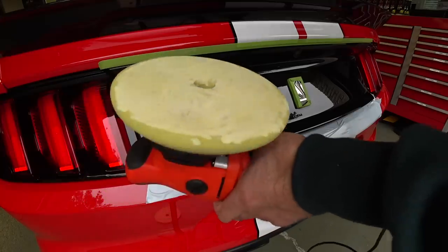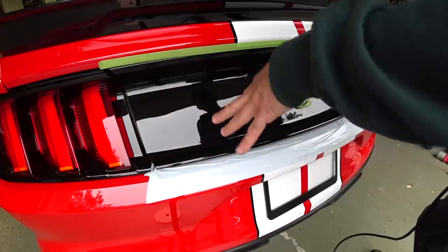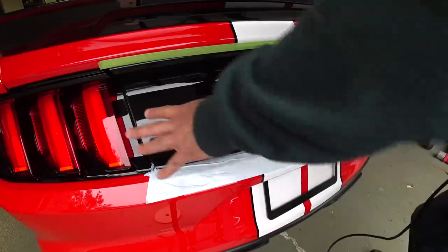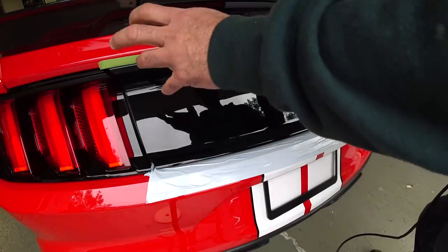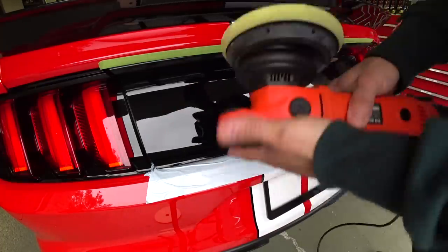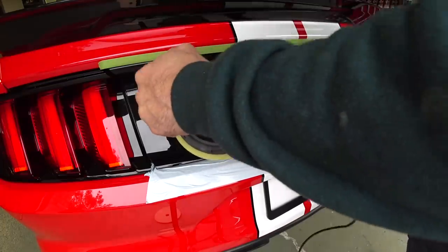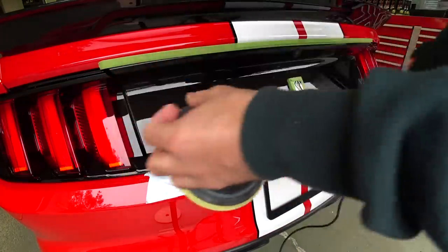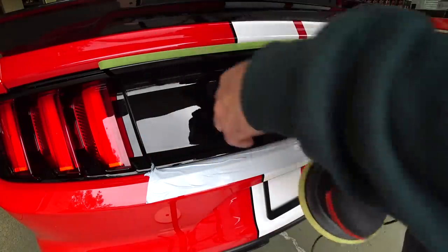Got the yellow Griot's pad with the Perfect It Cream. We started the job in the middle — didn't go with the fast correcting cream and a microfiber pad, we went with an orange pad and the orange Boss correcting cream. Now we're using the Perfect It Cream just to bring out a little more luster, because this is plastic, not paint, and you want to go nice and easy. Travel speed is important — move it along, don't go slow. Use the weight of the machine; when working with molded plastic like this, you don't want to bury the machine into the panel. Use the natural weight and gradually finesse it over the surface. Let the machine do its job. If you put too much pressure, you will destroy this panel.